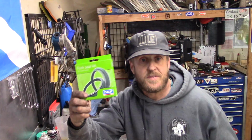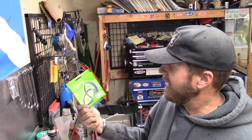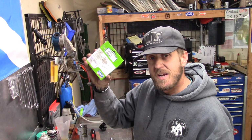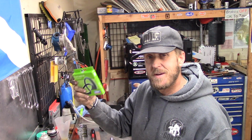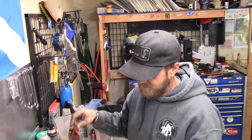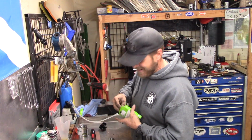We use SKF seals on all our forks, Japanese, Austrian, whatever. But SKFs are the best to use. The heavy duty ones are a little more expensive, but they really hold up really good. I'm going to put the link in the description for these seals. If you want to buy them on Amazon, they are 48 millimeter SKFs and they fit all KTM. So it's not just 4CSs. They fit the AERs, the old open chambers, the old closed chambers, pretty much any 48 millimeter fork from KTM, these will fit. So each kit comes with an oil and a dust.